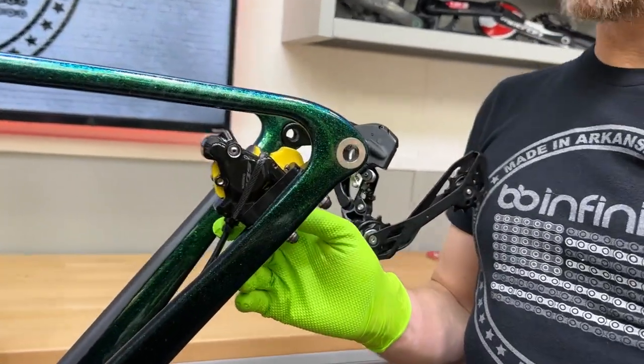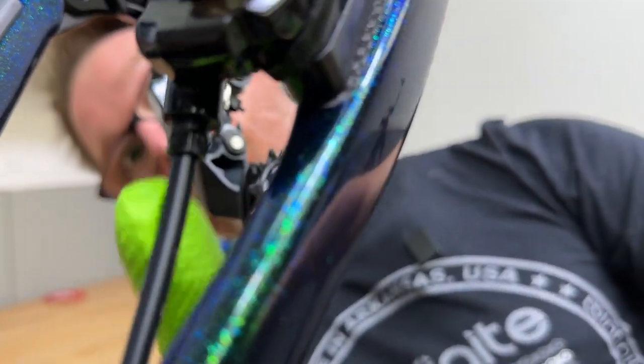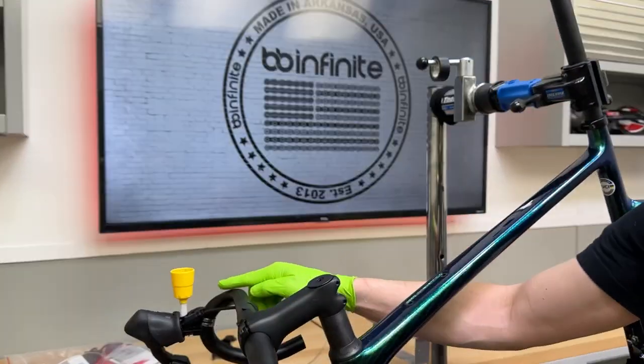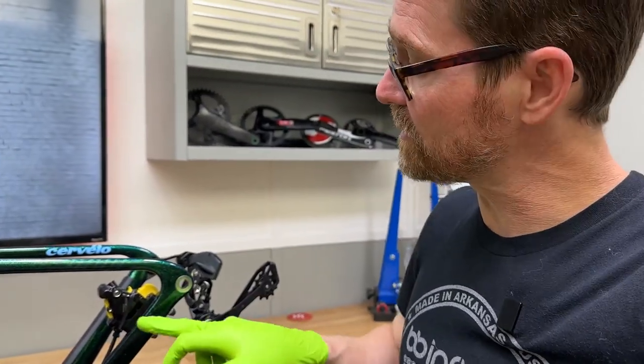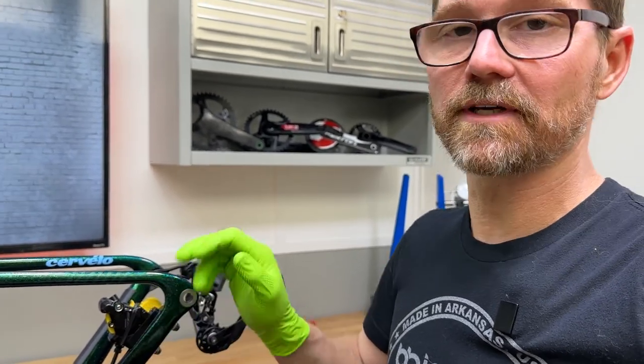If we remember what we were just showing on the test bench, the orientation of this caliper is critical — look at it. See this line right here? This line is in exactly the wrong orientation. This is the line coming out because we're pushing fluid from back here. We want the line on top, so we need to unbolt this caliper. If you try to bleed it in this orientation, you would simply be pushing fluid right into this area and leaving a giant air bubble right at the top.